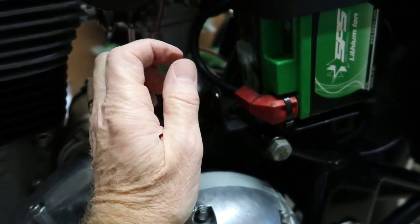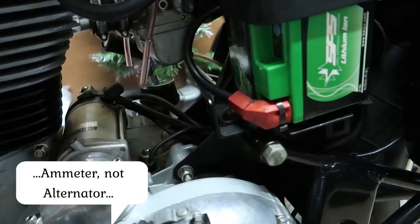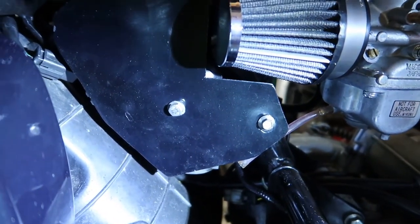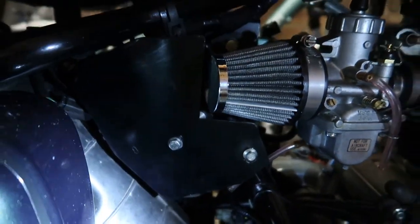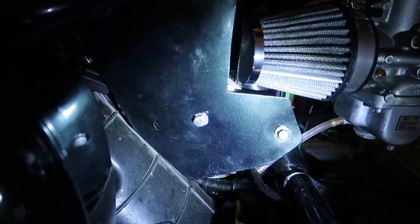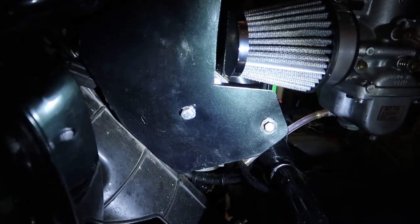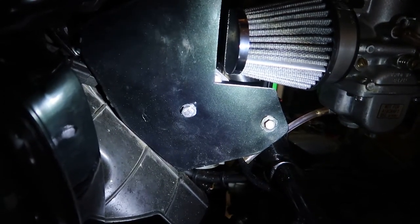So I'm going to have to cut that and extend that wire up so I can then split it and connect the ammeter into there. I've come around to the other side of the bike now and just disconnected the negative terminal from the battery. This black plate I'm shining the torch on — I'm not sure if that's standard fitment or not because of the modification on this bike. But I need an 8mm and a 10mm socket just to remove those two bolts and remove that plate so I can access the wire behind.